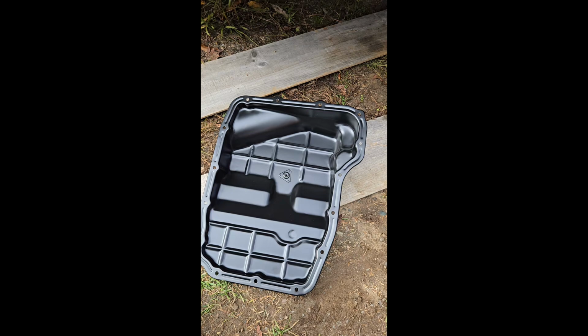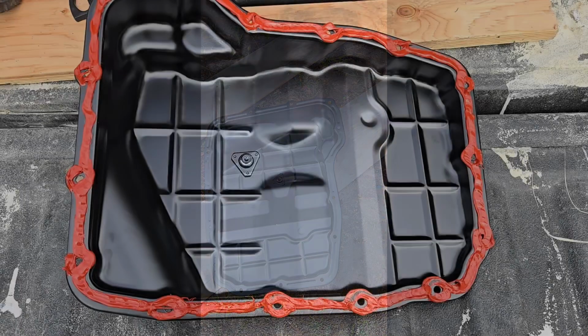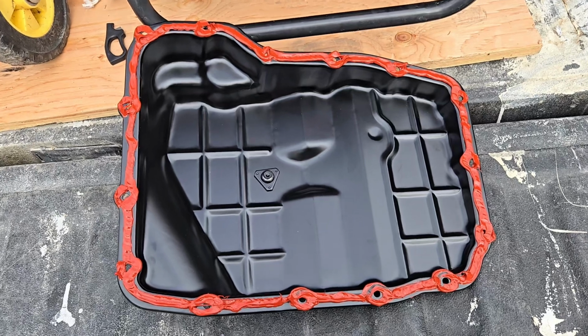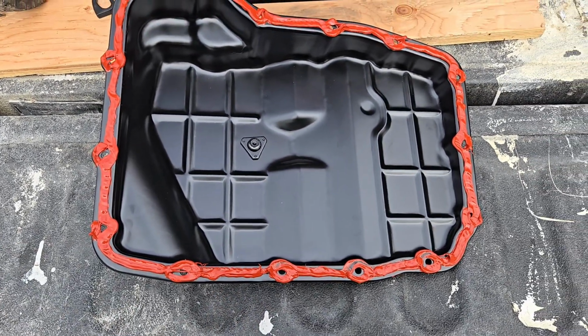And make sure you have your bolts handy. I have mine ready to go over there with the ratchet and all the stuff I need. Pro little tip. There, and you're done. Should look something like that. Continuous, similar thicknesses. Don't forget to go all the way around your bolt holes. Then you're ready to slide it on.